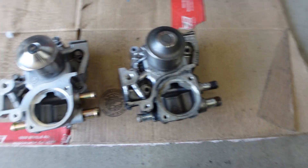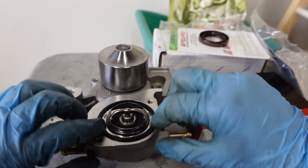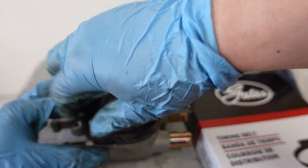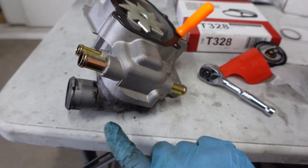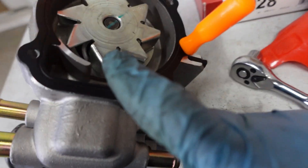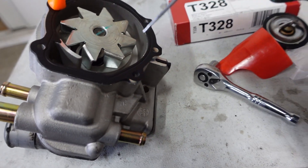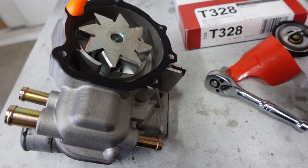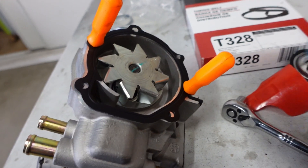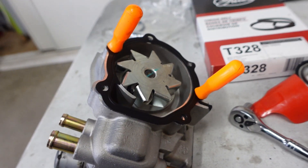The water pump is about to go back in. We got the thermostat and thermostat housing in, and we're going to put on the water pump gasket. A trick I saw on other YouTube videos: to keep the gasket on when putting it on the car, just use two picks or two small screwdrivers and thread them through the holes in the opposite direction. That'll hold the gasket while you put in a couple screws and you should be good to go.